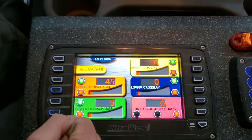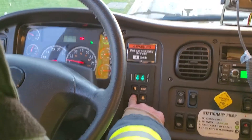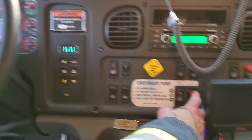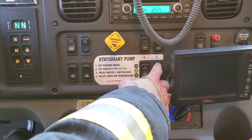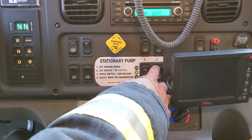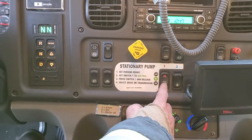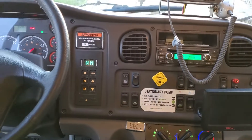To take it out of gear, put the truck in neutral with your foot on the brake. Once the speedometer gets back to zero, hit switch number two — it's a momentary switch and that light will go out. Then switch number one — put it back in the high range. Now the truck is ready to travel.